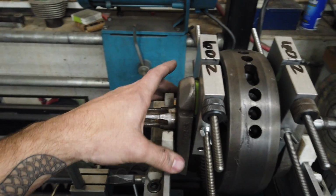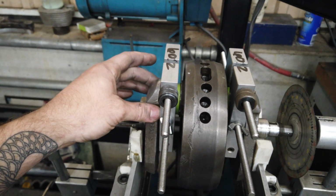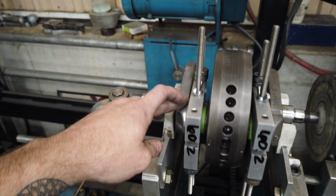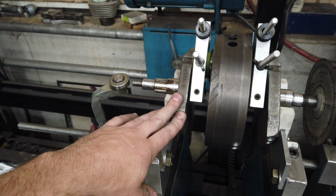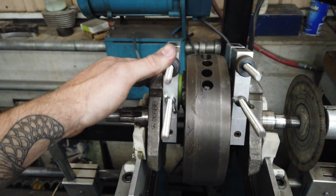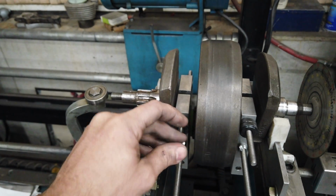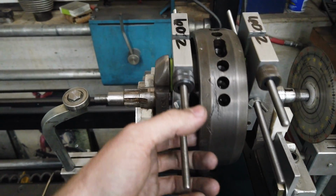And I used to actually chase it, and it would just spend so much time, and all for nothing. It's the diminishing returns situation again, where you got to kind of decide at what point is it going to just be good enough. You have to also remember how much oil is a factor in this situation too. When this thing is spinning inside the case, it's going to pick up and hold on to so much oil. So there's a lot of variables that I cannot correct, and you kind of have to pick and choose how much time you spend on chasing these small amounts.